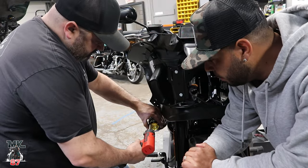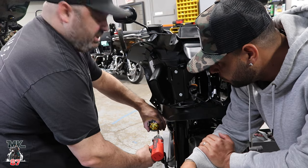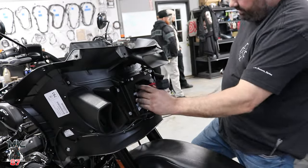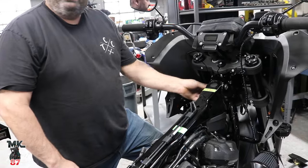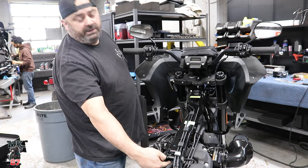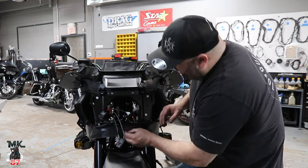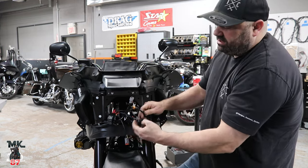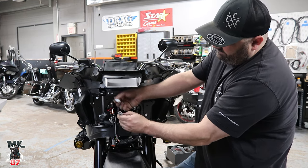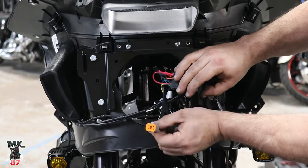In case you don't want to use the amber turn signals, you can also get the lenses in clear. They actually sell clear ones too. So that main harness is going to go all the way down to the battery. Soft tails have a plug on the side of the frame on this side, so we're going to pop this plug out, snake the wire down the backbone and get it to come out the back. We ran the Cali-Rays harness down the backbone out to the battery side. Simply for the hookup, you take your stock headlight wire and plug it into their harness. This is the wire we ran for the blinkers — that's what powers the blinker. Then we're going to tuck all this wiring away, and then this goes into the new LP6. Done.